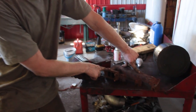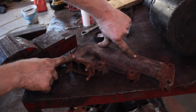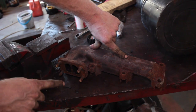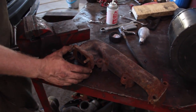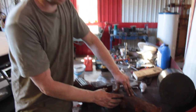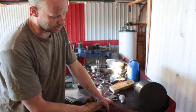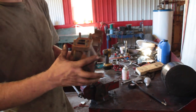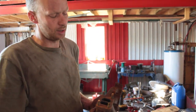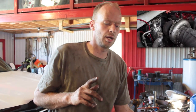What you can do is use the manifold off a 5.9 that was in the Ford 8000 — it drops straight down like the 4BT manifold. The 5.9 on the Dodge comes out on an angle, so if you want to build compounds and you're tight for room you could put a small turbo on anyway, or you can still use the 4BT manifold and turn it up with your turbo at the front. It's whatever you want, but that turbo is also not working.